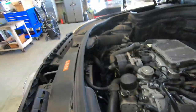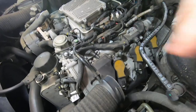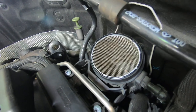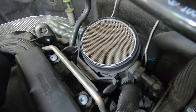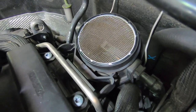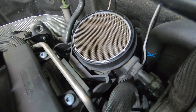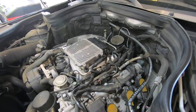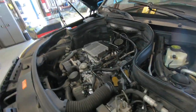2011 Mercedes got a random misfire. We tried moving — we're gonna plug in a coil from cylinder five to six. Listen to that intake. It's got a little suction noise in the intake intermittently, and that's when the engine shakes. I think there's a valve hanging up because of carbon in the valve. We're gonna try an induction service.